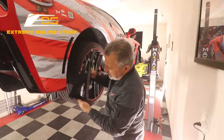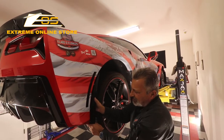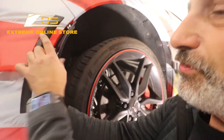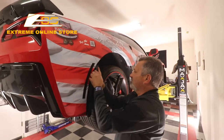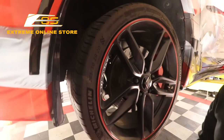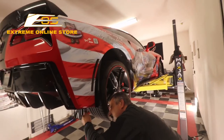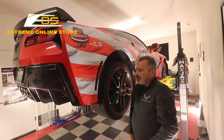We're going to go ahead and put this one in. You're going to get it right back in the slot where it goes, and then just guide these into the slots so you know they're going to fit in there before you force them in. Then you can just push them in — just like so. Sometimes you have to wiggle them in just a little bit. You can see that fits in there just like a glove — fits in there really nice. Then all you've got is your one seven millimeter screw to put back in the bottom here. We're going to snug up the other two, and that's all there is to putting on the rock guards on a C7.